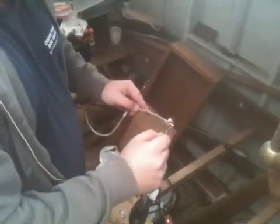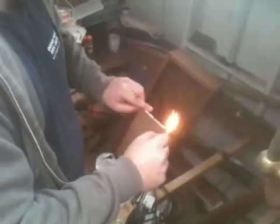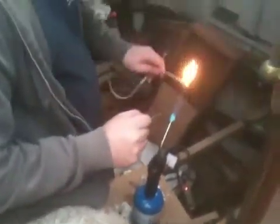Don't be afraid of letting it go on fire a little bit — it's not a big deal. It's going to be covered in heat shrink anyway. So I'll just tap some more on there. I've got a little piece of wood down here just so you're not dripping solder on your boat. This is an old wooden Chris-Craft, beautiful boat. So we've got a nice coating of the solder all around there.